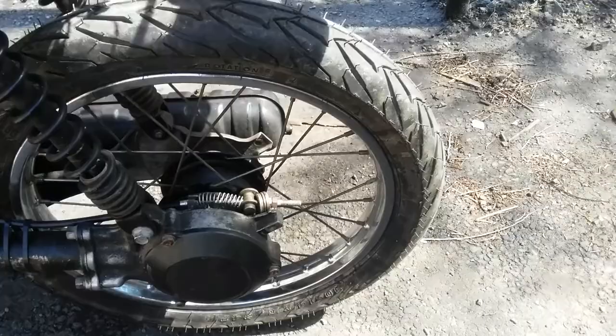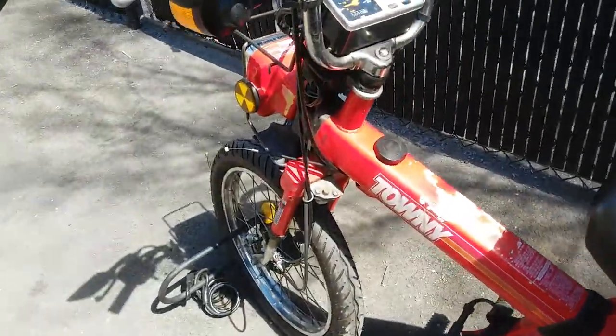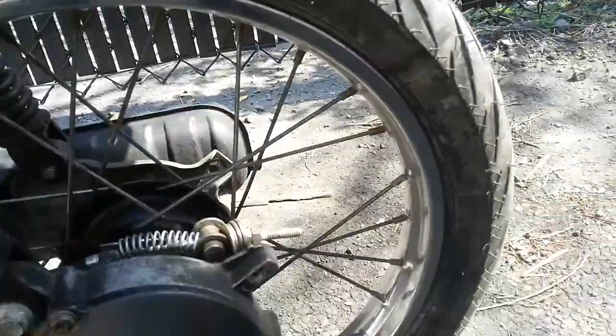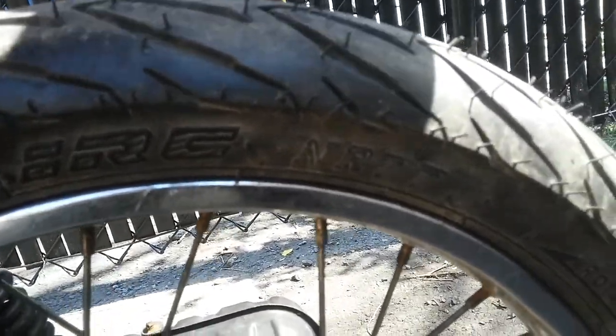I left the spokes as they are — it's a little wobbly in the back wheel but the front wheel is pretty true. I put brand new inner tubes and tires on both front and back. The back is a 14-inch wheel and the front is a 16-inch wheel. The tires I put on are 70/90 by 14 MC34P, made by IRC — model NR77 — and they fit perfectly.